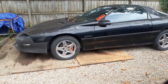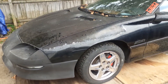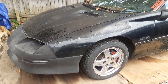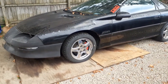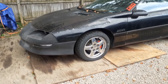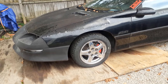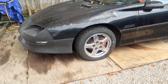Next up to remove the motor out of is Luke's car. I've got to pull the motor out of it because there's some parts I need to take off to finish his rebuild — like the oil pump drive and the reluctor mainly, and I need the timing cover. I'll get a full video on how to remove it on a stock-type car, because that right there is pretty much a stock car. It's still got the AC on it, and it has the off-road Y-pipe and the headers, so that'll be a little bit different.